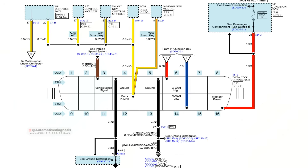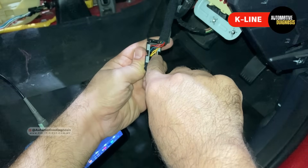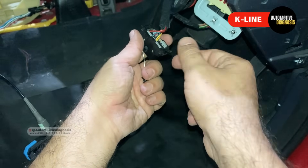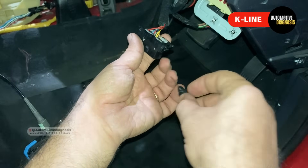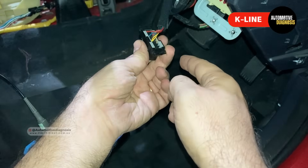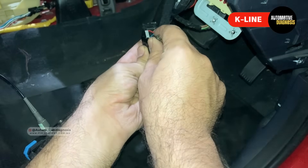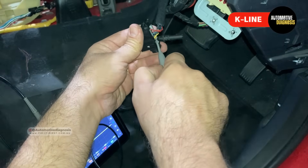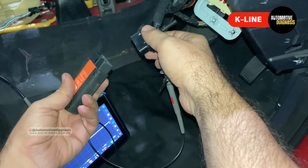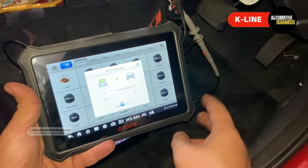For diagnosing the K-line, the best way is to find it and check it with an oscilloscope. On this car, looking at the wiring diagram, we have the body K-line on pin number 12 of the OBD2 connector — it's a yellow-red wire. I back-probe this wire, and I'm going to connect the scan tool as well to generate communication on the K-line, because we need to pick up the waveform when there is a signal. Since this wire is used for communication between the scan tool and control units like the BCM or immobilizer, any time you request something from the scan tool there will be communication to read.